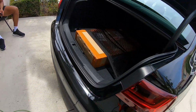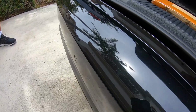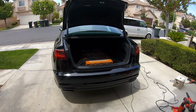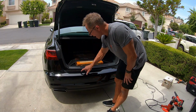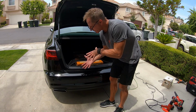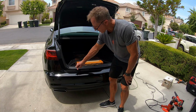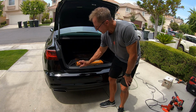So let's see if I can run it down the side. You guys can see the kind of skid marks, scrapes, scratches. So the problem is A, your clear coat is thin, which is a relative statement. It can only be thin based on something that's thick. If you're a beginner, you won't know. You also won't know how deep each one of these imperfections, scratches are in the clear coat either. So if you understand clear coat, which is good, you want as much clear coat left intact as possible. If you understand polishing, which is abrasive technology, you know the more you polish, the more you go chasing perfection, your clear coat is going to become increasingly thinner.